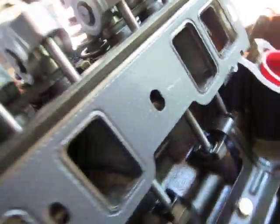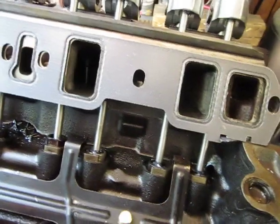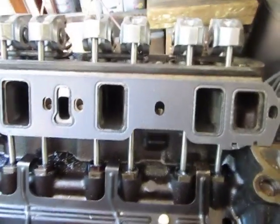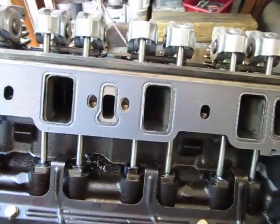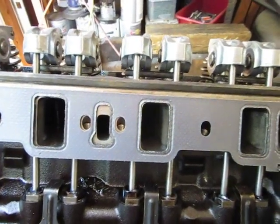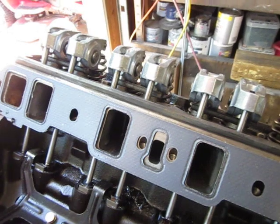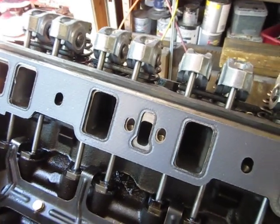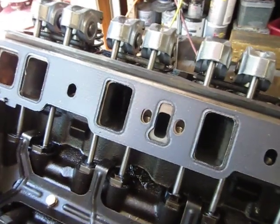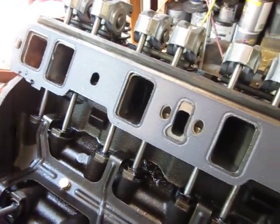Just something to point out to look for. When you put the intake manifold down, torque it evenly side to side so the ports line up good. On a stock GT40 Explorer lower, the ports on the intake are a lot smaller than the ones on the head, so you really don't have to worry as much about alignment. But if you get your intake ported by somebody like T-Moss, it's something to look out for.